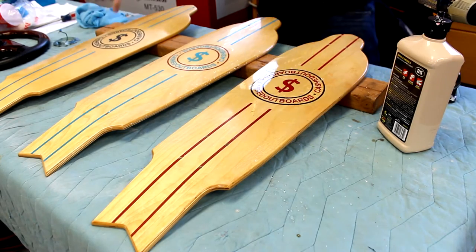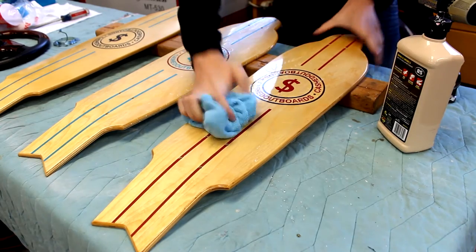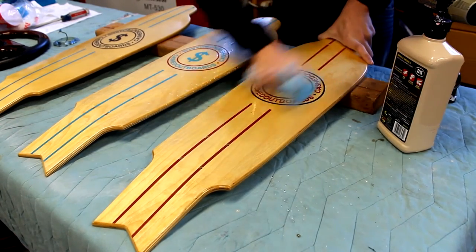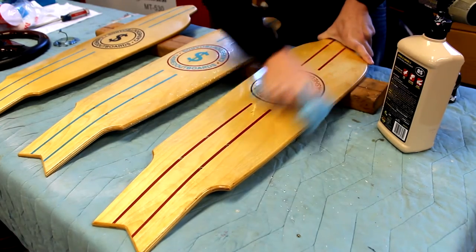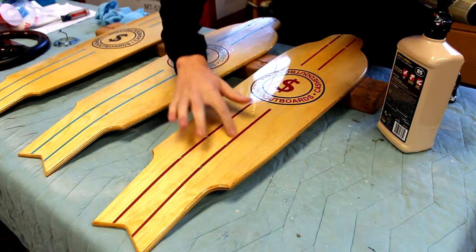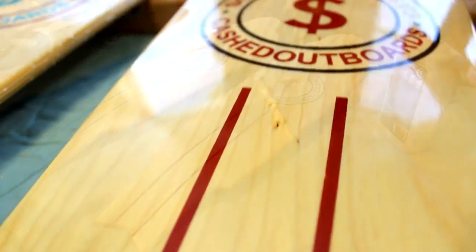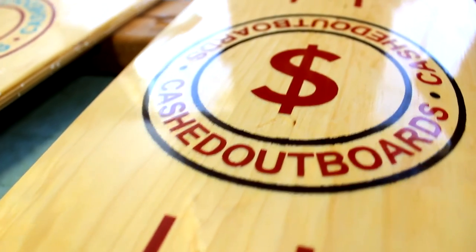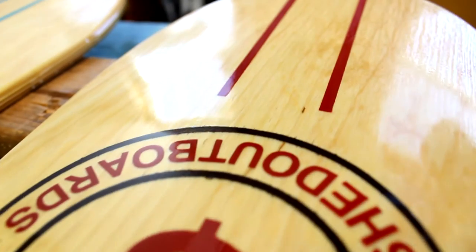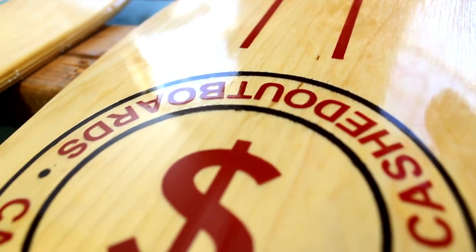To check your progress, just like when wet sanding, I like to take a microfiber and buff off the extra compound. As you can see, the area I just did is much, much more shiny and looks a lot better than the areas that were just wet sanded — I'll give you a close-up of that. It's also important to keep in mind that the buffing compound tends to go everywhere, so wear a bad shirt and don't do this in an area you want to keep perfectly clean.